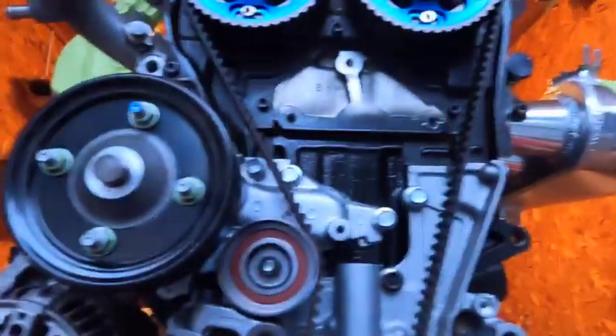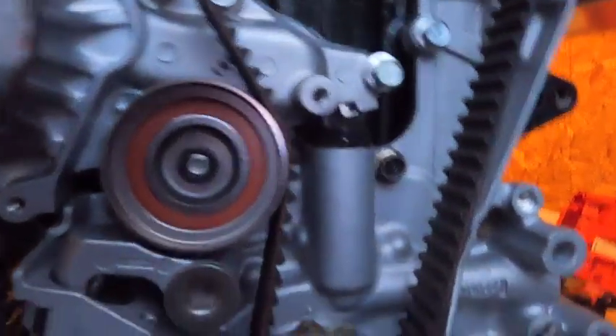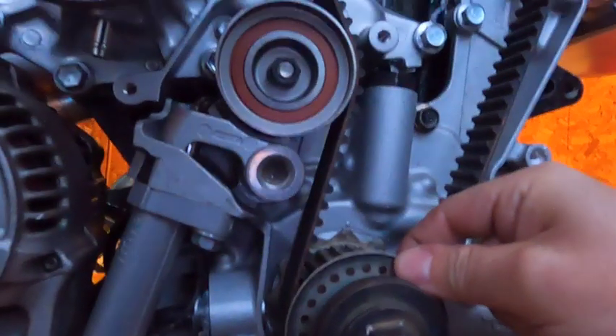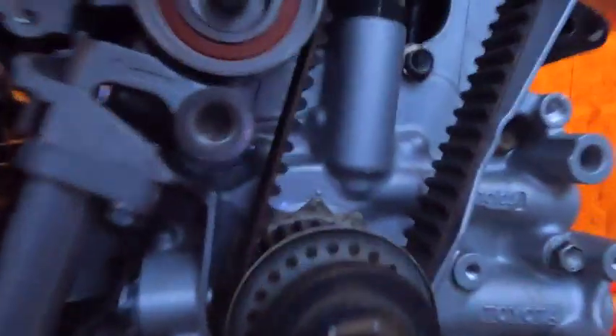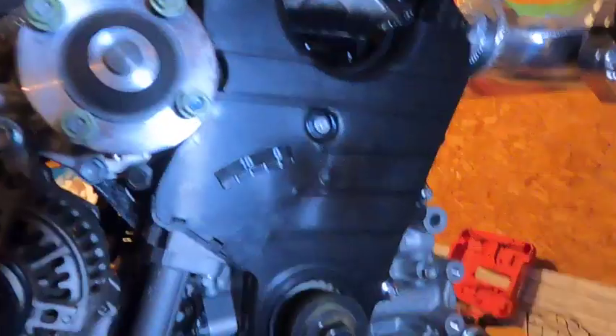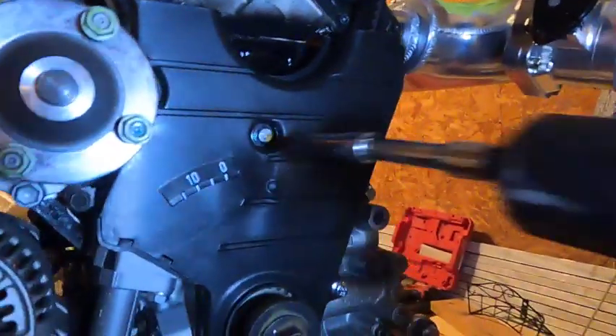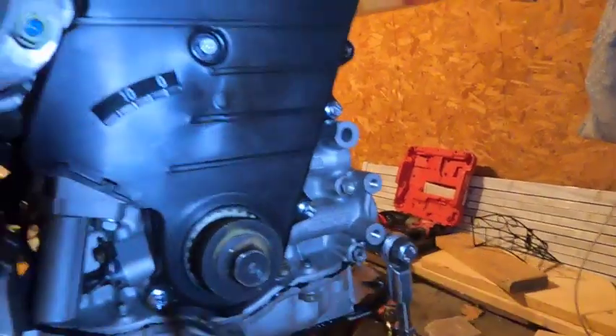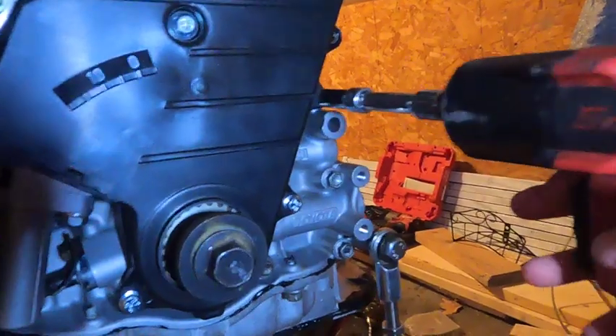You can see it's pretty tight — it's not coming off. That's it for the timing belt; now we'll just throw the covers on. After you get everything together, put your lower timing cover on. Make sure that this washer has the dull end facing in towards the belt so you don't shred up your belt — this does go on only one way. It'd suck to have to take this thing back apart. You don't want to over-tighten; don't crack the plastic. I've got them all hand-tight right now.